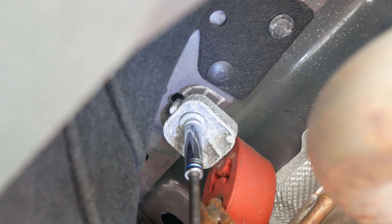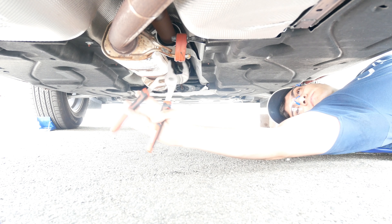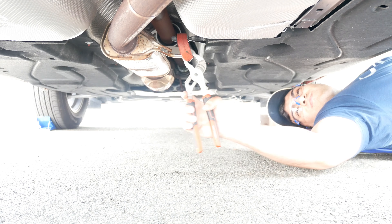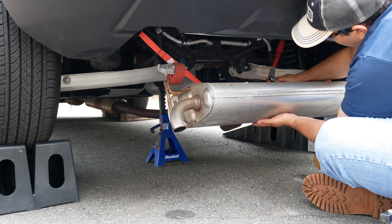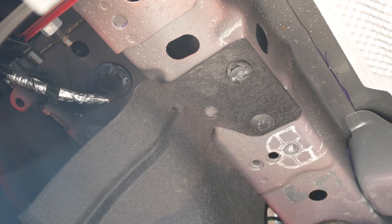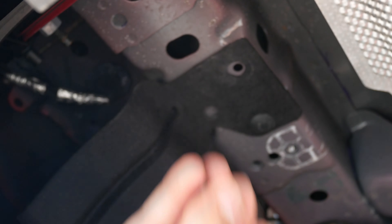Once we remove both these bolts, we can move down the car to remove this shock mount to help lower the exhaust. Spraying it down with some water helps to get it moving. Then we can use that ratchet strap to help lower the exhaust. Now we'll need to remove some plastic trim screws, and once we get those out, we can go ahead and push back this carpeting.